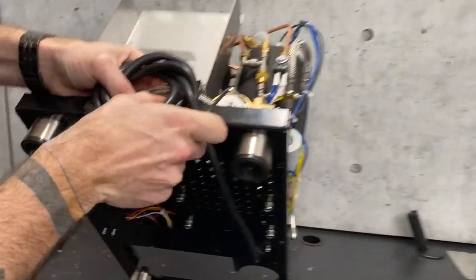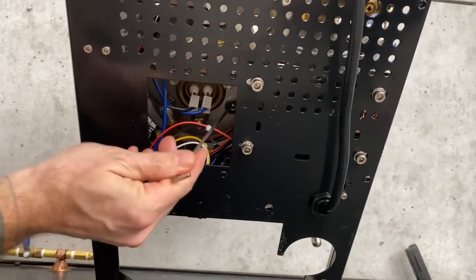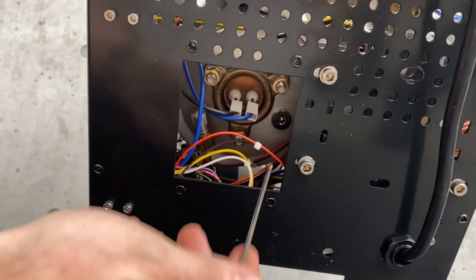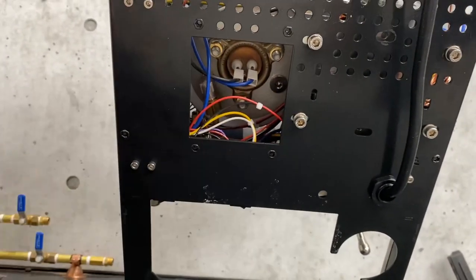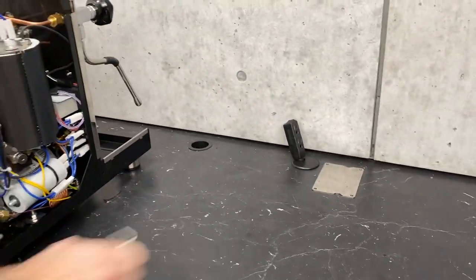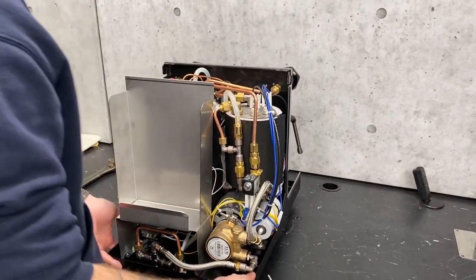So I'm going to show you on the bottom of the steam boiler now. If you see right here, you've got another plug on the bottom here. There's no valve under it, so if you open that up, you're just going to have water dumping out of there. That's a 6-millimeter Allen screw right there to take it out. You've already removed this plate over here that would normally be covering that up — this is the cover for it, and it's just four 3-millimeter screws to take that off. That's how you'd access both that plug as well as your steam heating element.